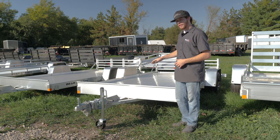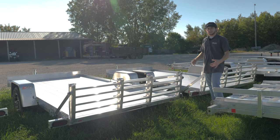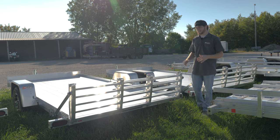This is a low profile trailer, so the front frame is cut down and the trailer deck is low to the ground. That helps with keeping wind draft from picking up the trailer and getting squirrely on you, especially on a single axle trailer if you're going to be pulling it with a smaller SUV or car. This trailer was really built for smaller SUVs to pull, and even light-duty trucks.